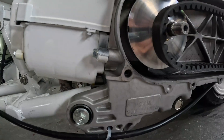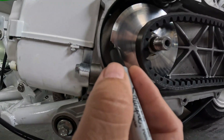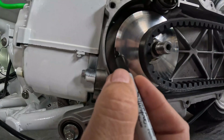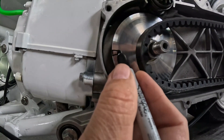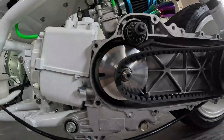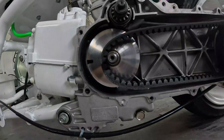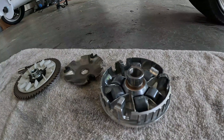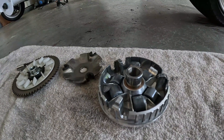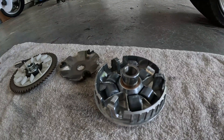Well, that's interesting. I suspected I would not be that high. You can see the belt is just about to the top of the variator. I don't see it going a lot higher than that — we're right there at the edge. To get more top speed, we need to go higher on the variator with heavier roller weights. Those three-gram roller weights look like they're going to the top. I'm at 9,400 RPM when I'm hitting 47 miles an hour — I don't want to go up much more. I like that RPM; I don't want to lose my power.